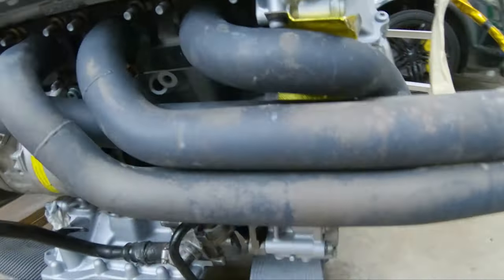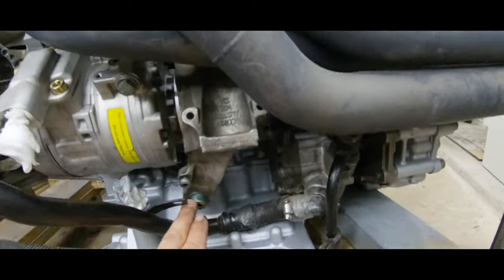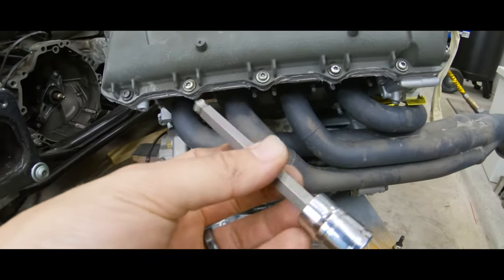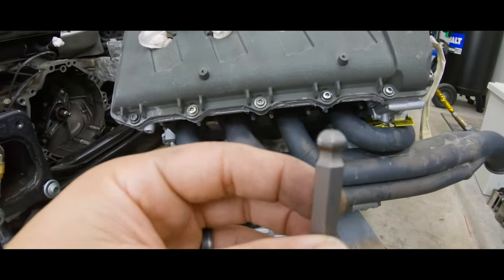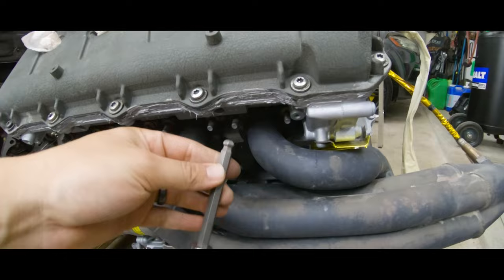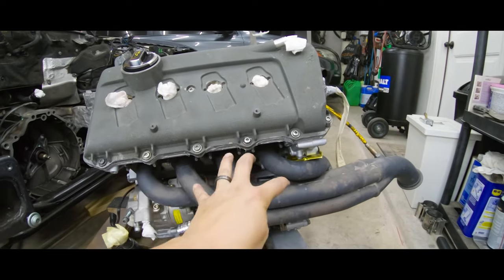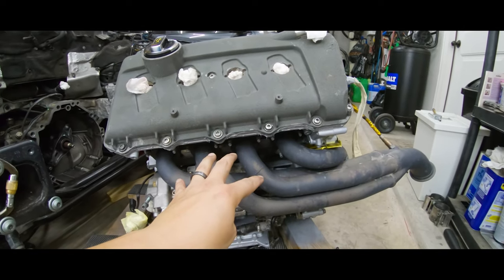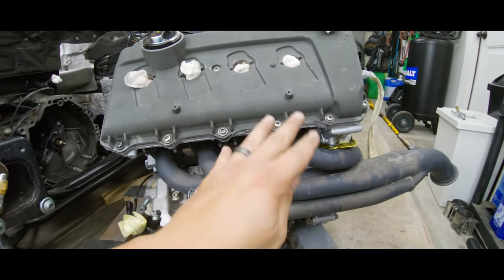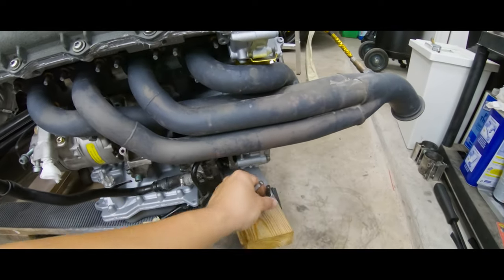The driver's side engine mount frame is on. Two of the three bolts are straightforward. For this third bolt you're going to need an 8mm Allen with a swivel so you can approach at an angle — you can't get to this bolt straight on. That's specifically for the JHM V2 headers. With OEM headers that's not an issue — you can get straight to it with a regular 8mm Allen.